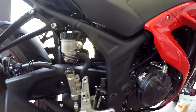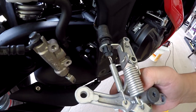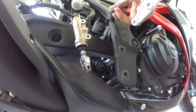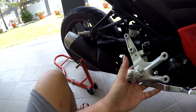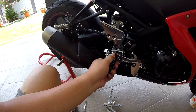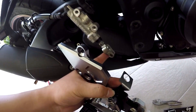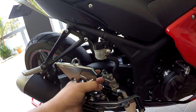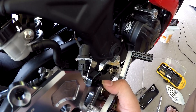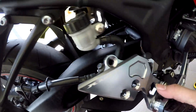After that it's quite free. I have to take out the brake light sensor - this is a brake sensor. Very easy to take out, just two pins - press it and then you can take out the original foot peg. Now it's time to put my Rapido racing foot peg. This is higher than original so before mounting we need to put the brake sensor first, after that we only put the bracket. Use the same technique - just plug in. Done - brake light sensor installed.